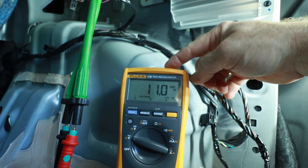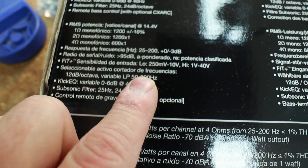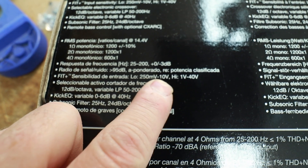What we saw there was 280 millivolts. Now 280 millivolts is really nothing. The amplifier we're going to be looking at has an input sensitivity on the low level input side of 250 millivolts to 10 volts. Even though it's a little bit higher than what that amplifier says, that means we're going to have to turn the gain up all the way in order to get any form of signal out of that amplifier. I don't really like that - more than likely you're going to get some kind of noise introduced into it. That means the line level output of the factory radio going into this amplifier is not a good option for this particular install.